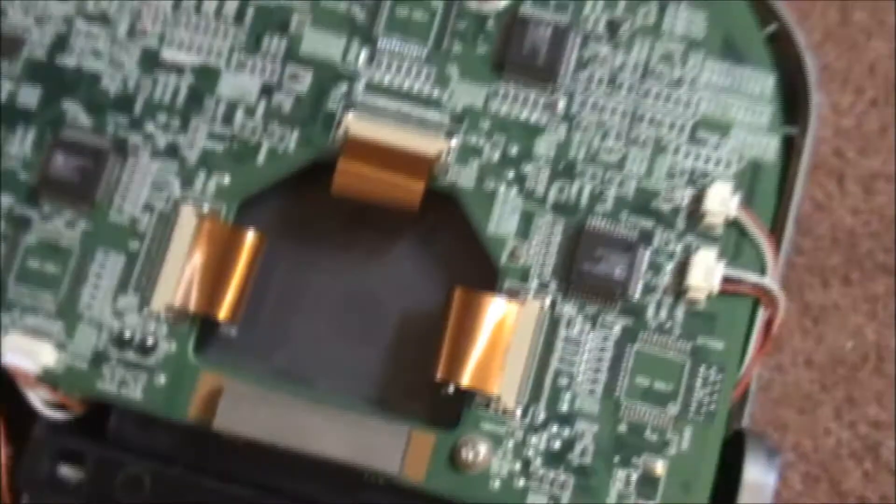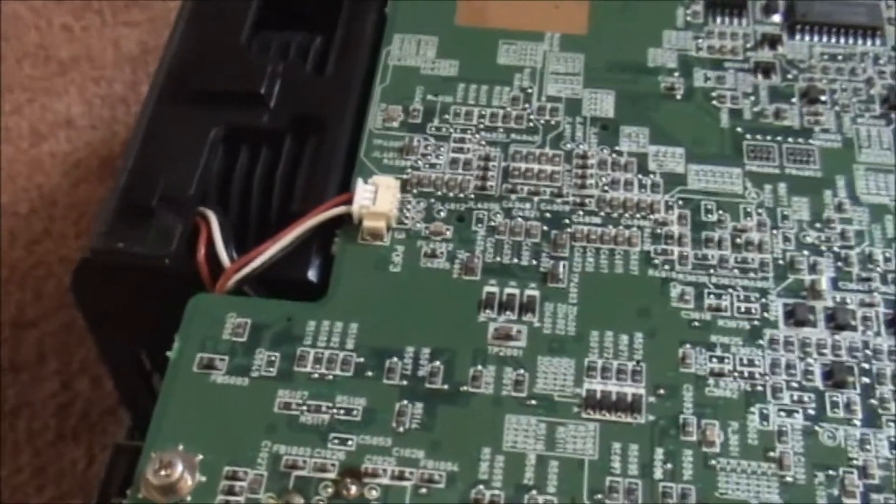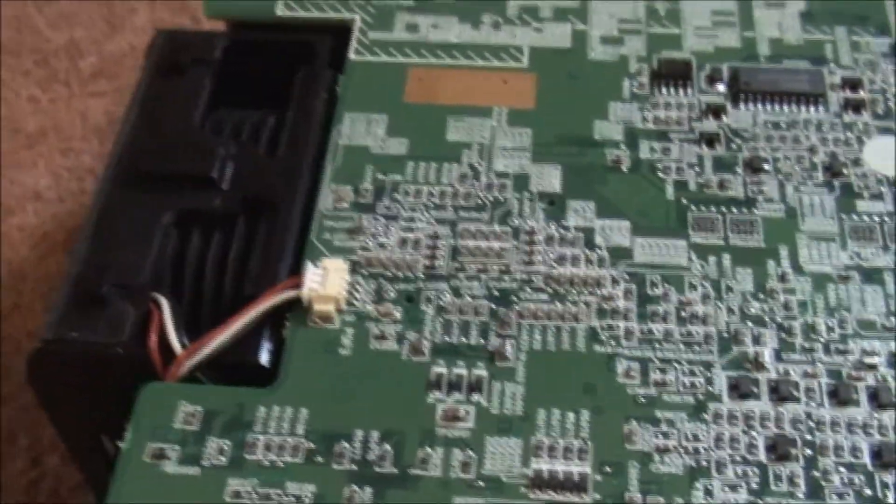There we go, the top's off and we can see all the lovely electronics inside here. It's very similar to the other projectors I used to work on. Here we have the RGB — I believe the signals in for the RGB colors go down to a small light box which has the RGB colors. You've got your various fan connections and sensors. If you disconnect one of those fans the unit won't turn on — it's very clever, it does a little checksum. On the flip side of this board you'd have the processor and the controller. Some of these chips catch my eye — one in particular could possibly be video memory, though I'm only speculating.